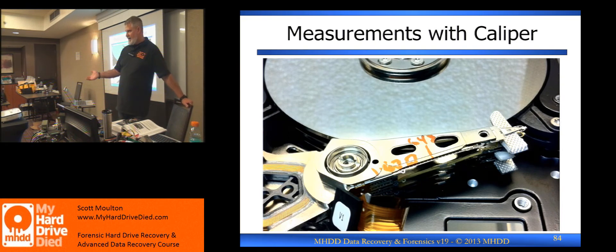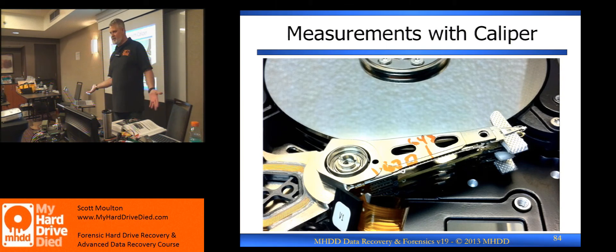That's the only real science I can add to this. You will get to a spot where it won't matter, because you can feel it — you'll become one with the drive. You'll feel that screwdriver lock in, see the drive respond. It's a little harder to do on an Atola because it will constantly power off and back on. A PC-3000 gives you a bit more of a fight, but you can do it. The DeepSpar is the easiest for me because I can see and respond to it right away.